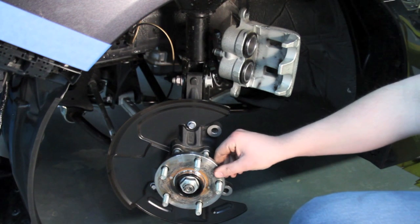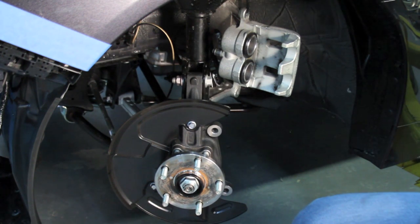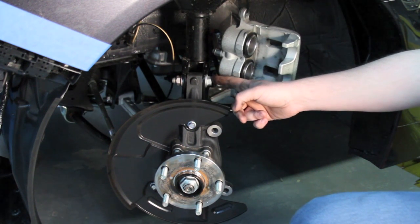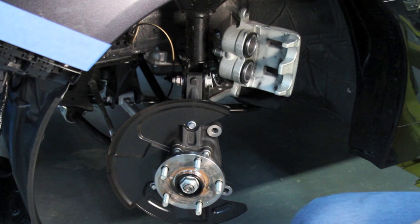The hub surface is a lot beefier and thicker than I would have remembered it. Also, you can see up here — this is a camber bolt that most Subarus have, especially WRXs — and it looks like you can definitely add a lot more negative camber, probably about another degree or so, for added handling and turn-in and overall grip in the corners.